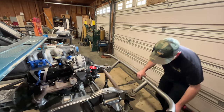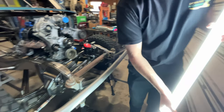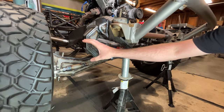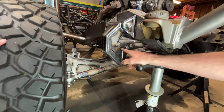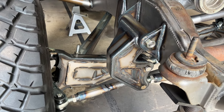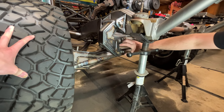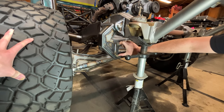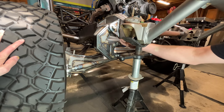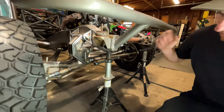As far as the swingers go, I wanted to keep the design consistent with everything else going on — the overlays have the same similar pocket style setup as the beam and the beam mount. I just made the swingers match that. As far as ratios, originally I had the bolt hole locations closer together, which lessens the steering ratio. I ended up pulling everything out, which is why the frame needed to be notched — but it quickens things up and gets more steering angle out of it.